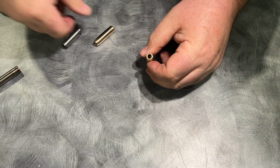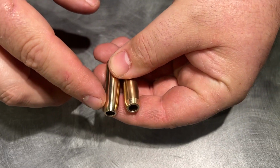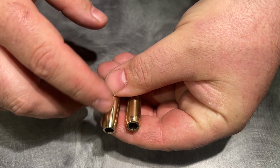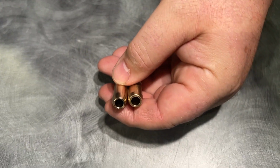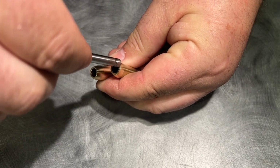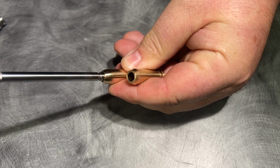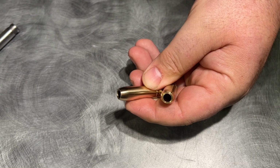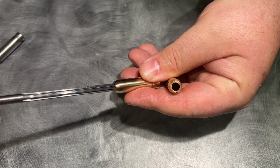Now different manufacturers are gonna have a different size hole. Now you can see the GSC guide. I was talking about the taper. See how the taper is very, very nice and smooth. So this is an easy, thanks Greg, he listens. The inner diameter here is actually smaller than this one, right? So you're thinking, oh my gosh, I can get a valve in there and I can't get one in here. Almost get stuck, but it's no problem because we can stick our reamer in and get it to size.